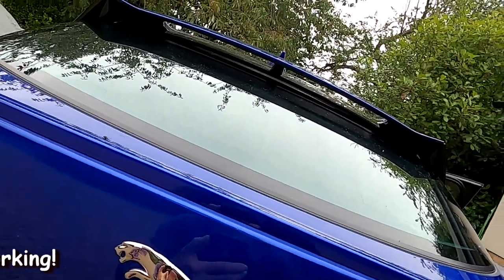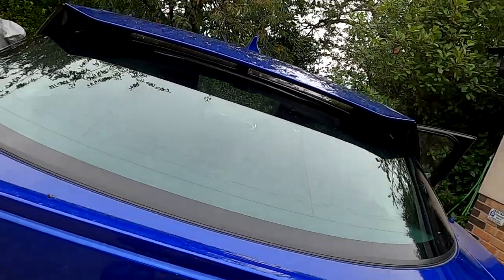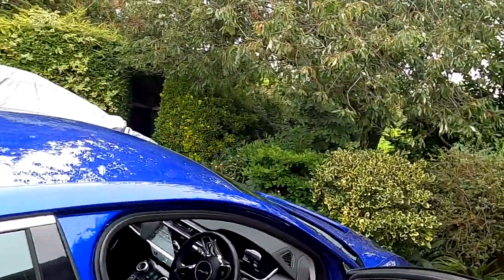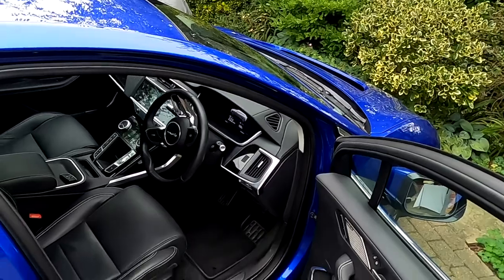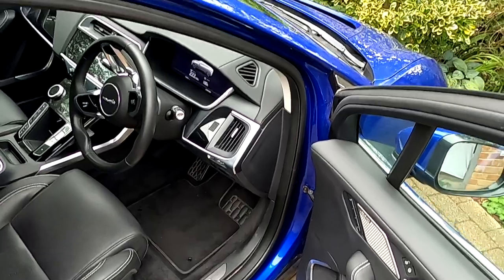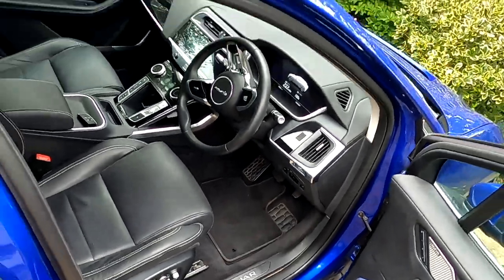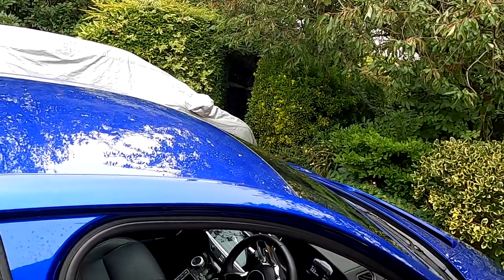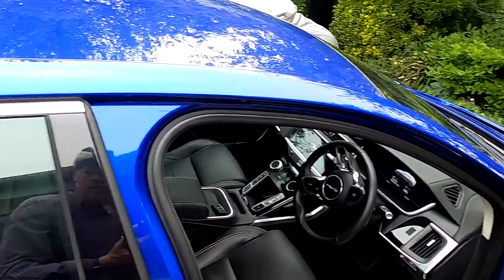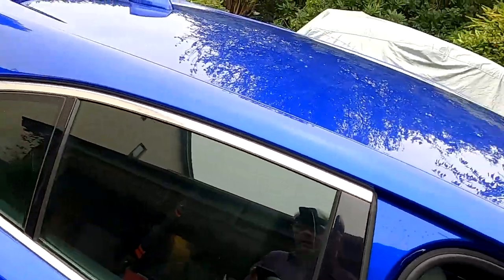right at the back. You can see the central bar. That will require taking the spoiler off, and I'm also going to have to take the trim from the side of the dashboard off and fit an OBD power supply to the socket underneath, because I reckon that's going to be more effective than taking a power supply from the fuse box under the rear seat.